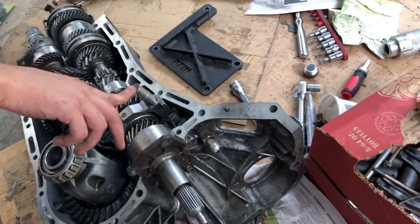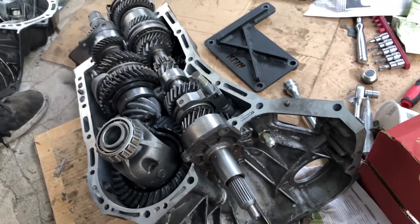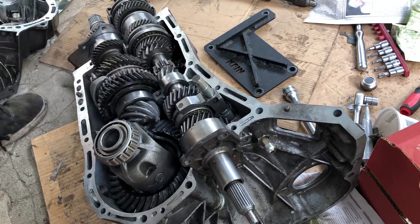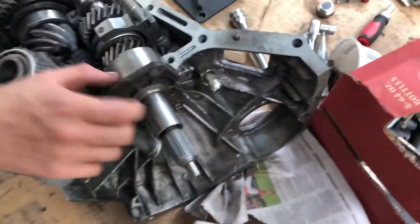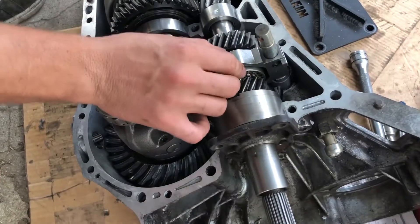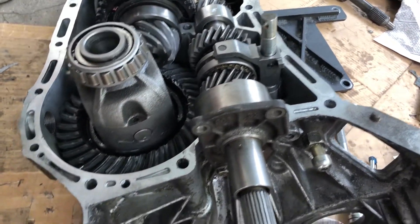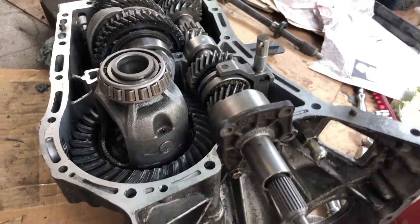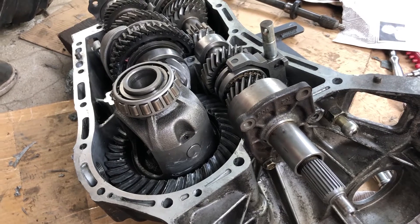This is a mechanism you need to be careful with. It got set into neutral and I ended up ripping apart the entire transmission because I didn't know about this mechanism. By the time I found it, I had foolishly triggered it forward without the relevant part in place. You don't want to mess with it while the transmission is open. The synchro is loosely built and fell apart — I had to look up videos on how to reassemble the synchro and the pin, which caused a lot of trouble.